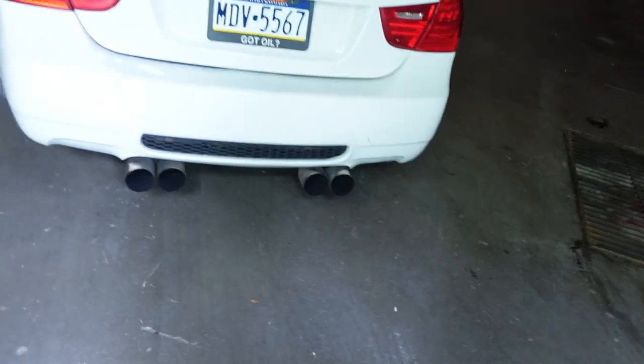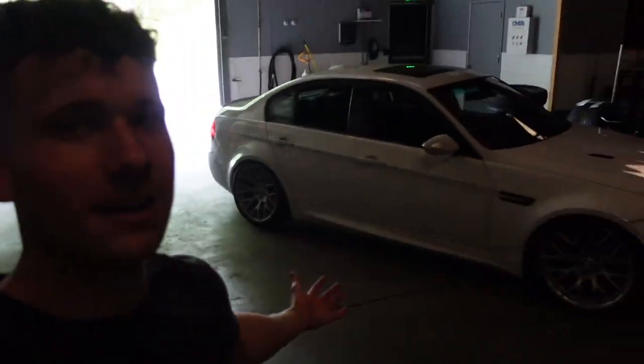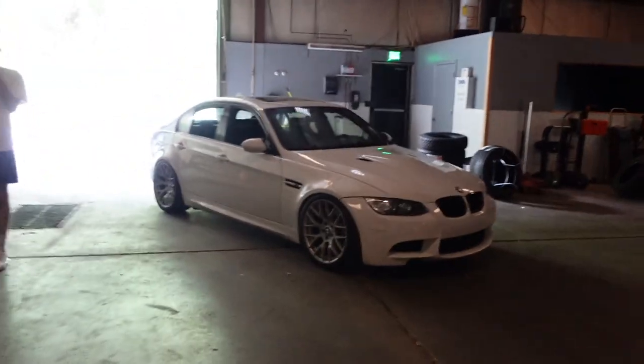From six to eight grand it feels like it pulls way harder — not a lot harder, but it feels like it's just not as choked up. I still have the secondaries in. I think what I'm going to do is order two Vibrant Performance two-and-a-half inch mufflers like the one on my E30, put them on there, then take the secondary cats out. When I get it tuned we're taking the cats out — flames, in a four-door sedan!